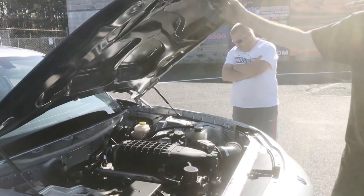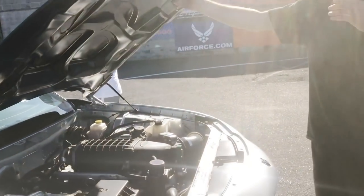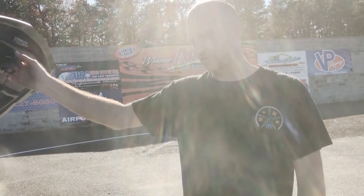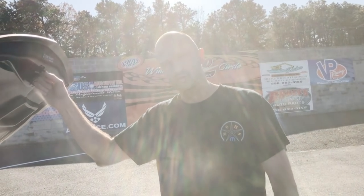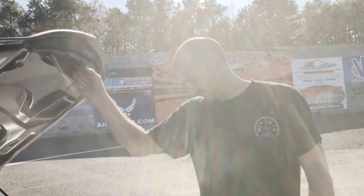If those calculators are dead on. But my mile an hour has always been high for the times I run. So what's your mile an hour? Like 135. I just did 137. So 135 and running 10.50, that's a lot of mile an hour for a 10.50. So you know there's more there. Basically, if I could get the car off the line in first gear, it would be even. But it won't. With the 410 gears, I just annihilate the tires. Yeah. All right.